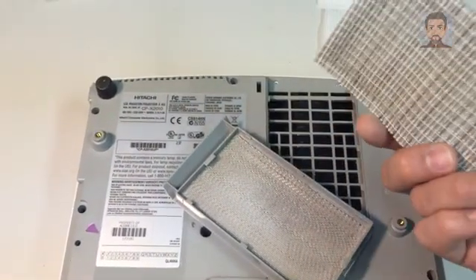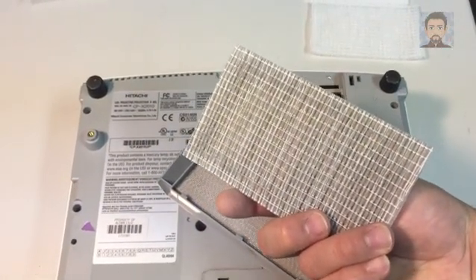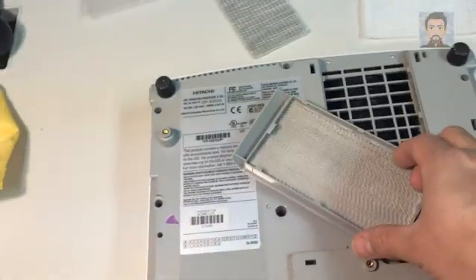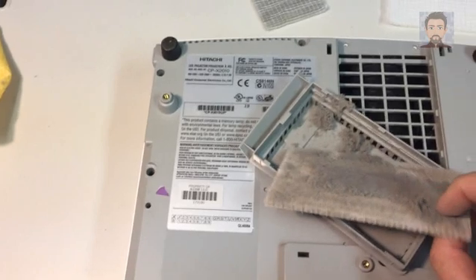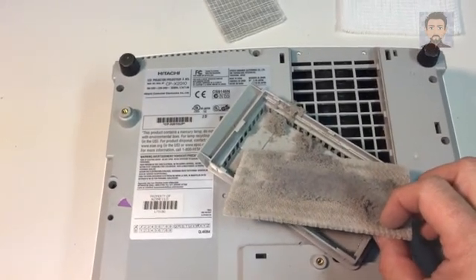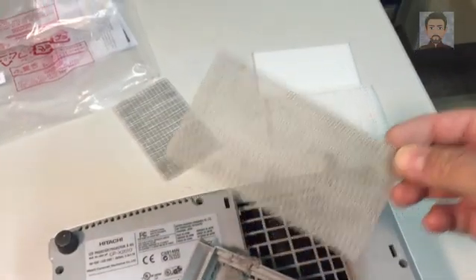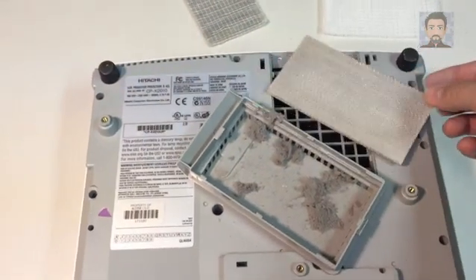Normally what you would do is take this out, turn it over, and blow through it. We're actually going to replace it today. You'll notice there are two layers — this is the main layer, and below you also have this second one, which is pretty bad, and you'll want to blow that out. First thing most people do is take it to the trash can and hit it really hard to knock the dust loose. You can also blow through the element and get it nice and clean.